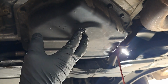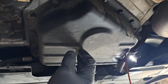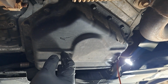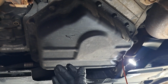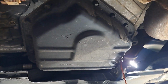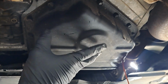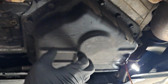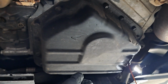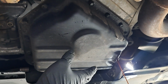I'm gonna do that. Replace the oil pump. I have a Melling oil pump that was brand new. So I just need to see if I can remedy this oil pressure issue. And I'll give a lot more details at the end. But right now, since I figure I'll document what I can as far as where I am now, and explain the diagnosis in the latter part of the video. So mainly I want to get this pulled down, see what it looks like on the inside, and I'll give more detail about what happened after we get the oil pump replaced and look at some PID data. Hopefully it's pretty detailed, but I need to see if this pickup has sludge buildup or metal.